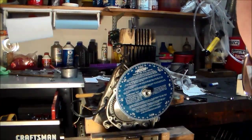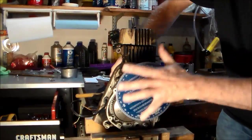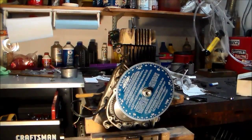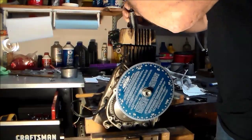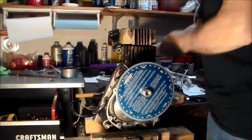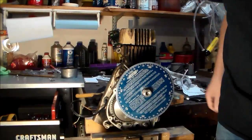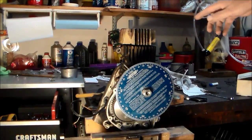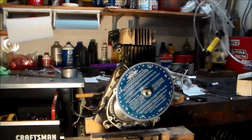I'm at 24 — roll this way, and 24. So now if I take the bolt out, I'm going to bet big money that that's top dead center. That's how I do it. Now I can pull the head and visually check my transfer port timing, exhaust port, intake, and all that. For ignition, I did that on my H1 to see if the little tab was bent right, but the reference mark for top dead center — anyway, thanks.